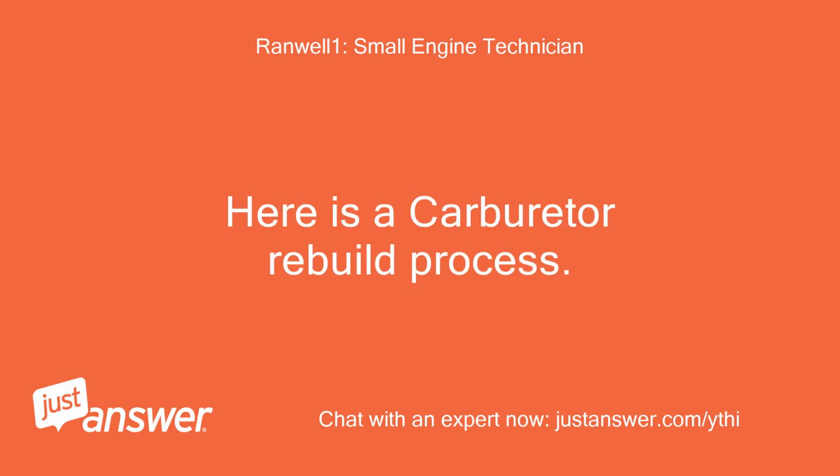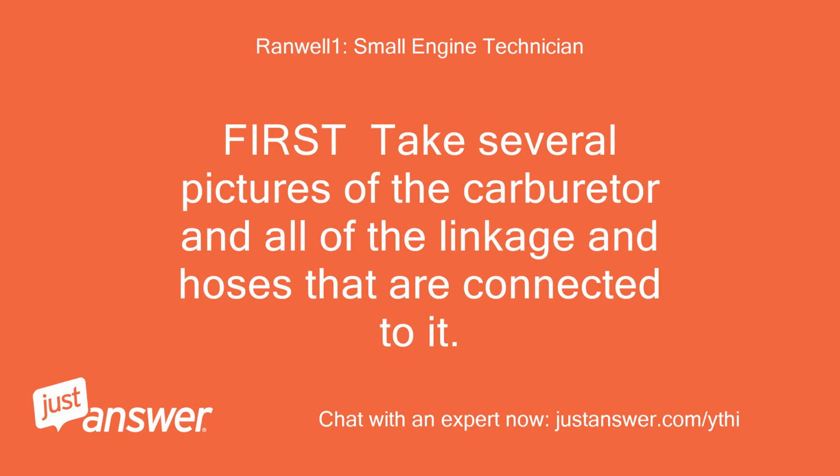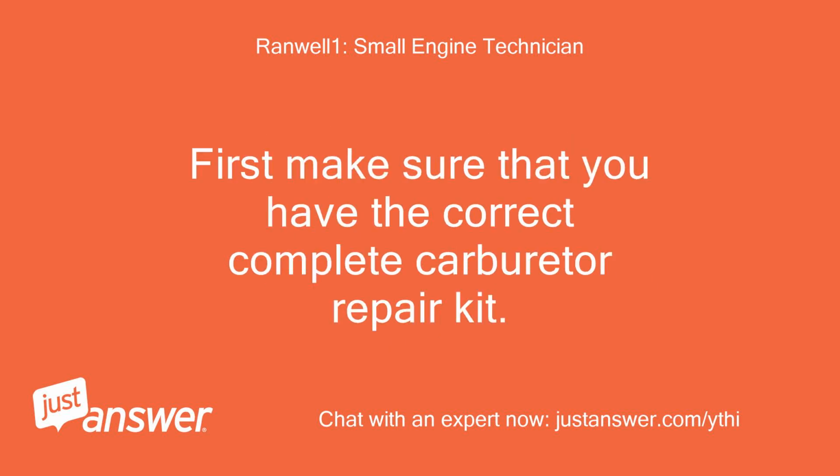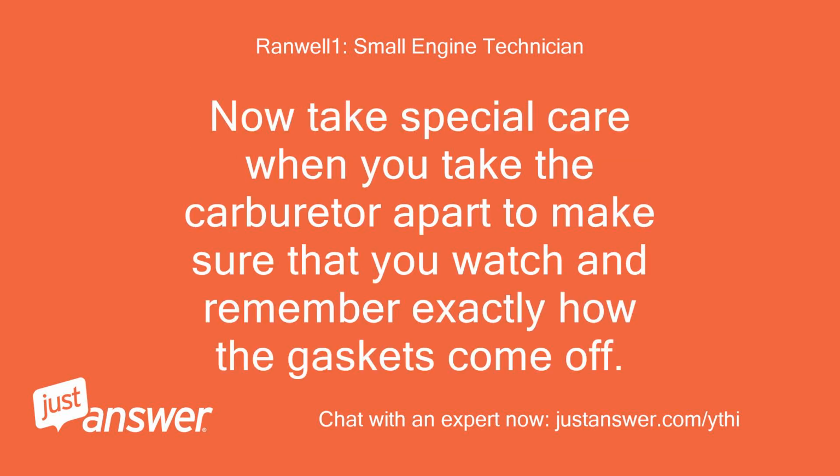Here is a carburetor rebuild process. First, take several pictures of the carburetor and all of the linkage and hoses that are connected to it. This is to make sure that you will have a guide so that you can get everything reassembled correctly. Also, make sure that you have the correct complete carburetor repair kit. Now take special care when you take the carburetor apart to watch and remember exactly how the gaskets come off.